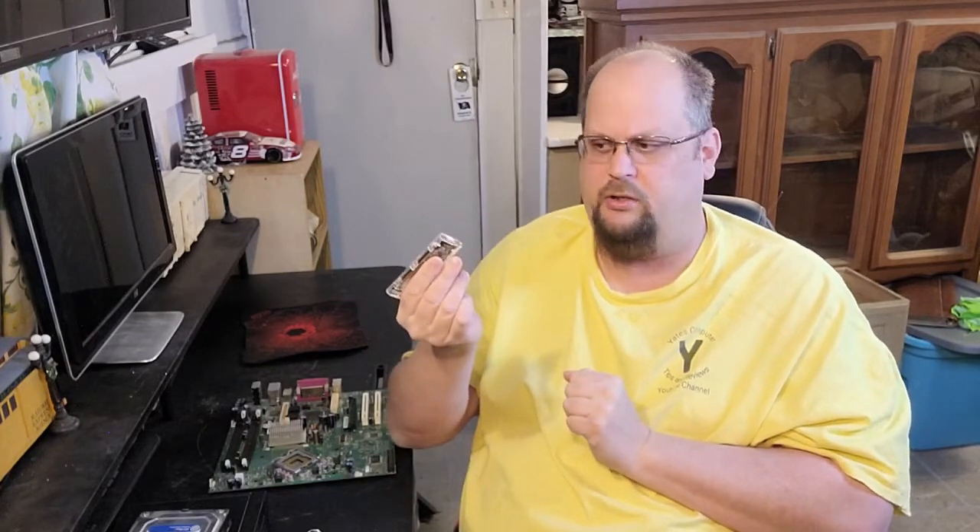Power is important here — as you can see, this external case has no power cord, just a USB cable, so the power comes through USB. This ties back to my power supply video — all these devices that plug into computers draw a lot of power. You want to make sure your computer can support that and that you have a big enough power supply. A lot of pre-made systems come with 150W, 200W, or 300W supplies, which can be limiting.